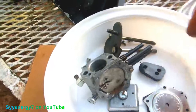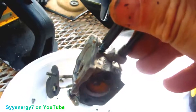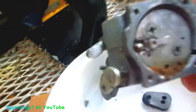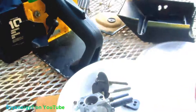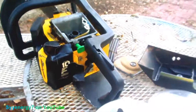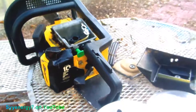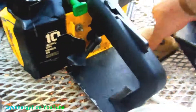I'm going to take out the high side — this one here. Look at that crap in there! Holy shit. That is why I wasn't getting full power — I was getting about two thirds. This thing at half power, quarter power, cuts pretty damn good. That is why. When I first rebuilt it, it was going great, the carb. And since that time, I don't know — something happened to it. Some dirt someplace, probably in the filter. I'm going to put the filter in there too, in the ultrasonic cleaner.